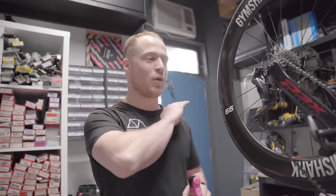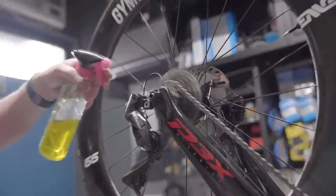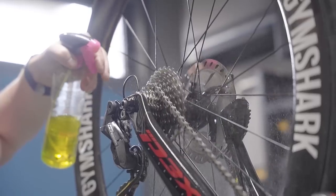So we are going to run through things as if you had come through from a ride and want to take care of your bike bit by bit, as if you were at home, starting with Dougie degreasing the bike. Okay, so you've just come in from a ride. Whether your bike's soaking wet or whether your bike's nice and dry, the first thing you'd really want to do is just kind of start degreasing the chain. So start at the cassette. You're basically going to apply liberally.